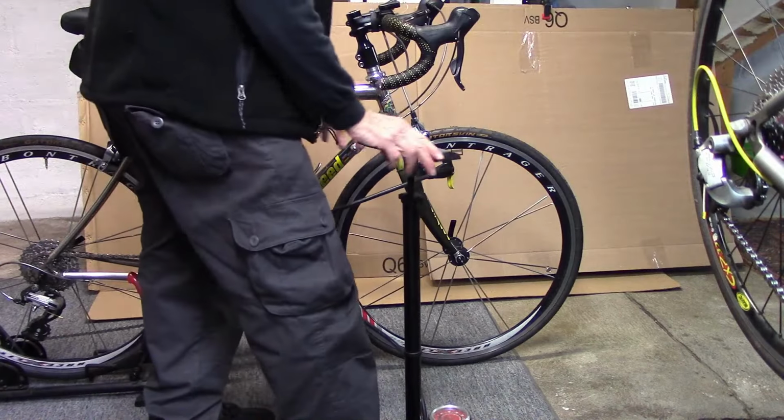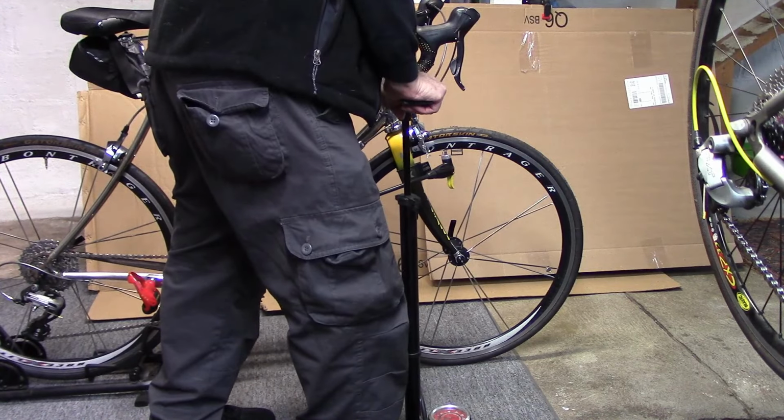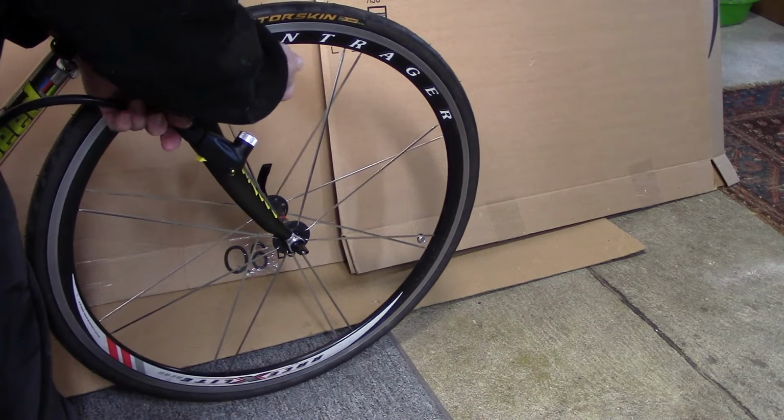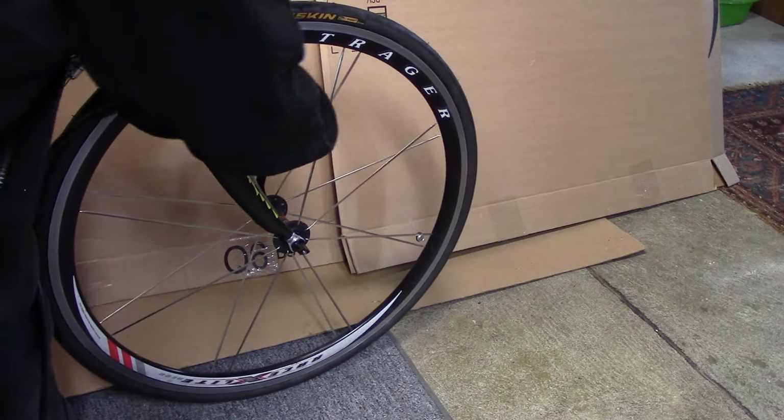Probably the most common problem we run into is we go to pump the tire and it gets a lot of resistance. And with this resistance to pumping, the gauge goes sky high. Presta valves are notorious for sticking, so give it a few taps before you go and place the chuck on.